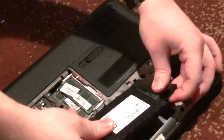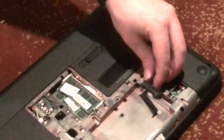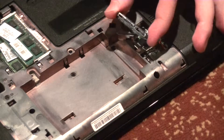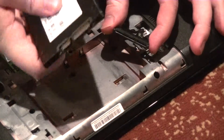Once it's free to move, disconnect it. Most of the time all you'll have to do is slide it backward, but in this case the connectors are on a free wire, which you can simply pull off — there's no locks or anything you have to worry about, you literally just pull it off. Right there is the connector to the power supply, and there's the one to the motherboard. They'll usually, if not always, be attached to a single rail.